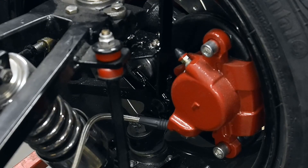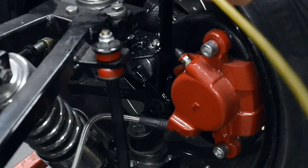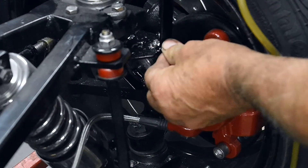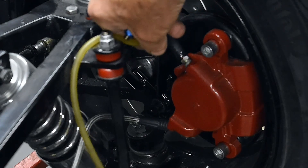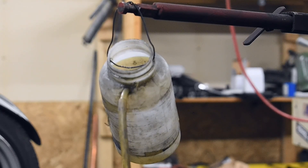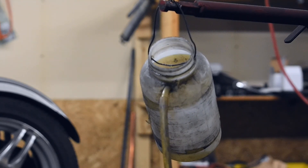I made a little adapter here with regular soft plastic — I think it's surgical hose — with some brake line and a 90-degree bend, because there's a fender bracket right there. Pull the cap off and this thing slips right on and makes a nice bend and won't come off. I always mount my bleeder bottle — just a plastic bottle with a hole drilled in it and a hose stuck in — higher than the caliper, so any bubbles that come out will stay up in the line and travel up to the highest point.